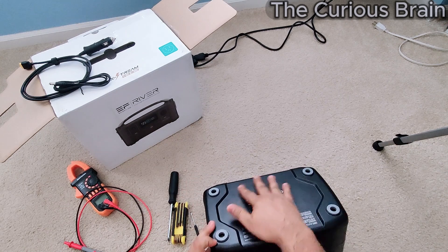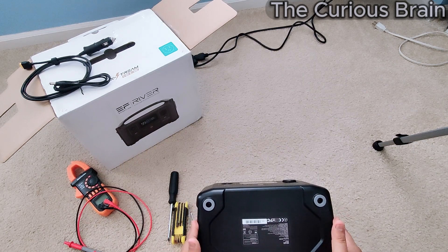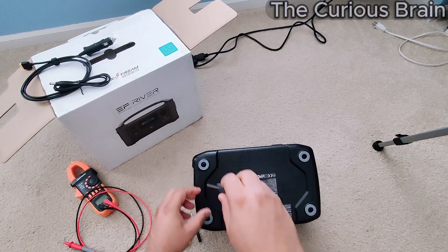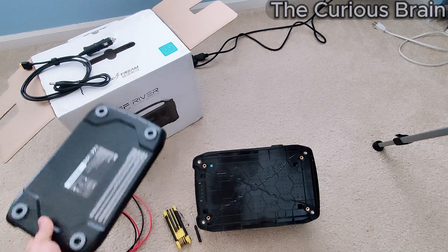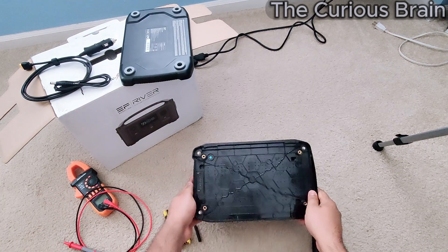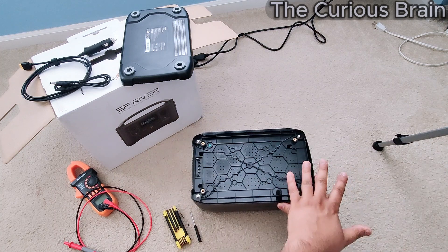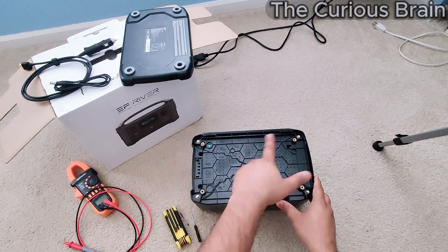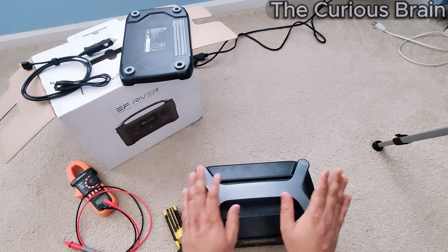At the bottom there are a few screws, but you don't really mess with these. The only time you open those bottom screws is when you're adding a separate expansion battery pack. I'll quickly show you: you can see the metal pins — this is where an additional battery pack connects, basically expandable with an extra 288 Watt-hour pack. You slide the new one in and put the screws in. But if you're opening this for repair, you don't touch the bottom area.